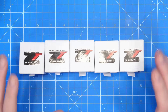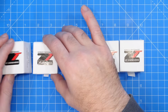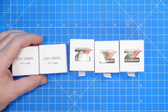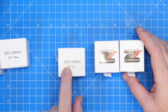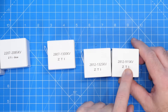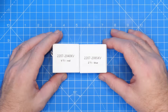I've been sent over five sets of motors to take a look at from ZT Innovate. We've got our more traditional five inch size motors and then we've got some bigger ones here for larger builds. Size wise we've got 2207 2040kV and a 2207 2085kV for the five inch, and then our bigger motors: the 2807 1300kV, and the 2812s available in 1325kV and 915kV depending on what you want to build.